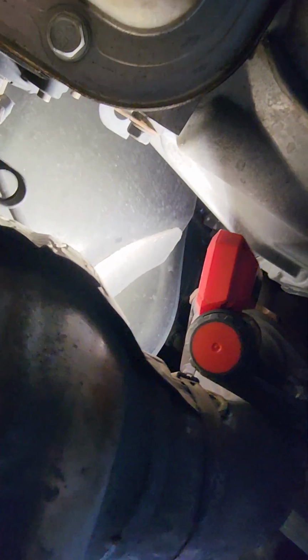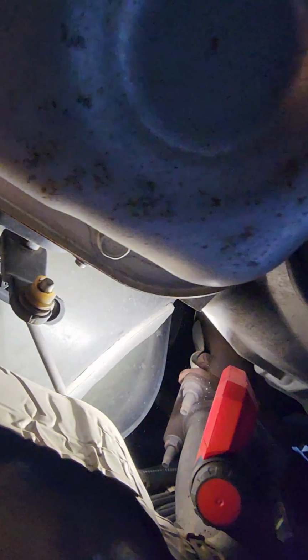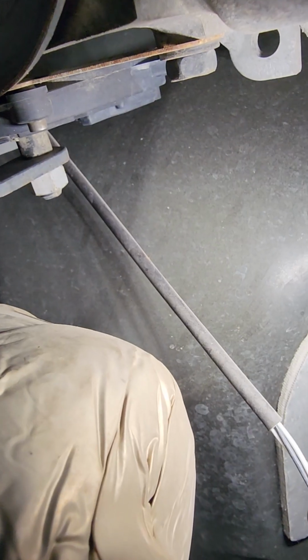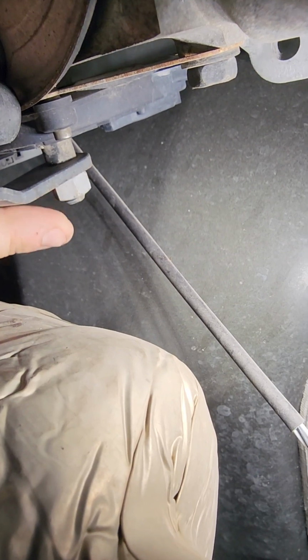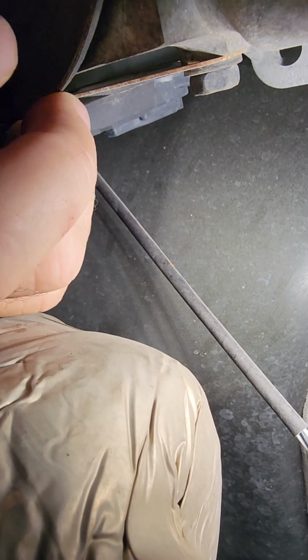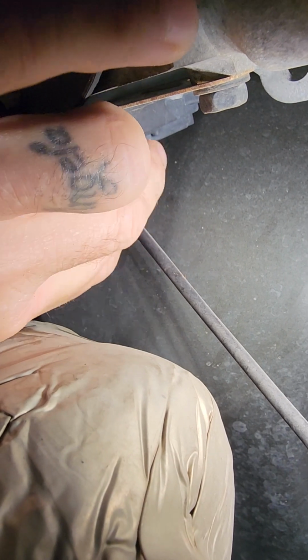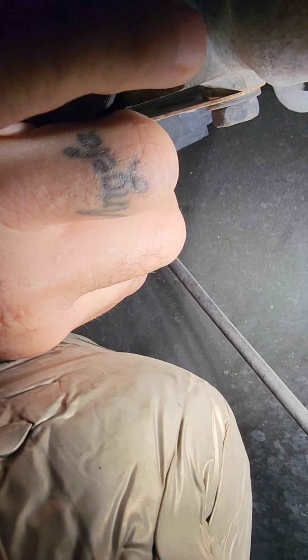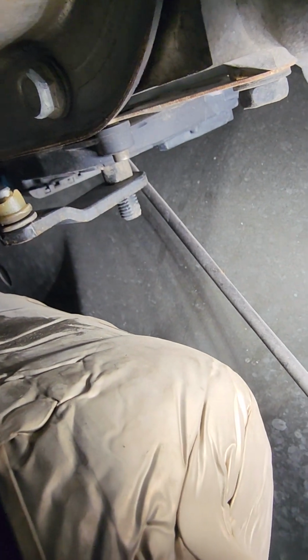And what you're gonna do is, number one, you wanna make sure you do not move this cable. Wherever it is, however it's disconnected, leave it in that position. Otherwise, you'll have sequencing shift alignment problems later. So there, you can see that nut. Let's see. So this nut right here, which is a 15 millimeter, we take this off. I won't pause the video, I'll just keep it going. All right, so set that aside somewhere, don't lose it.